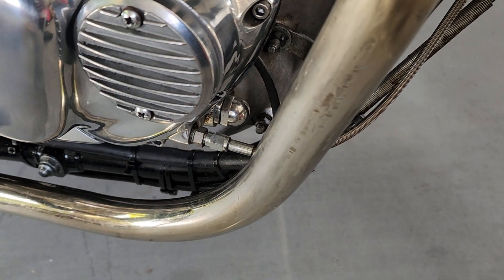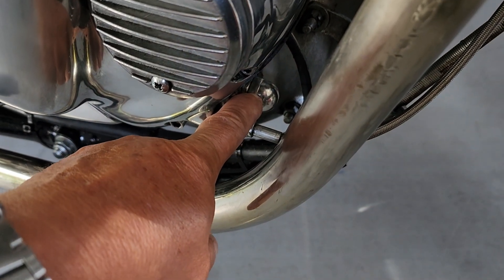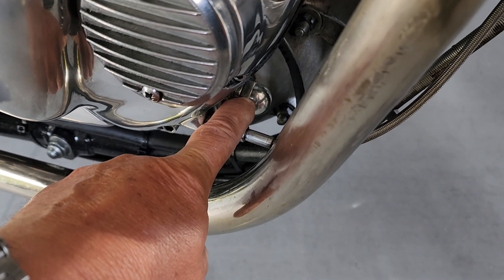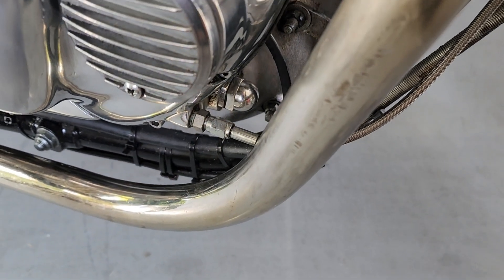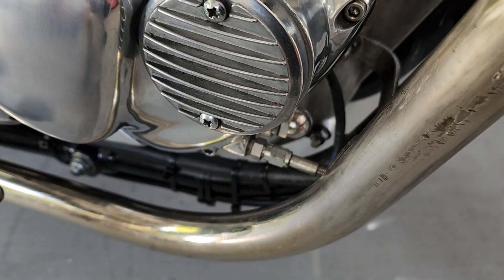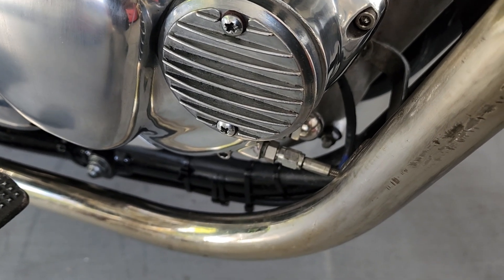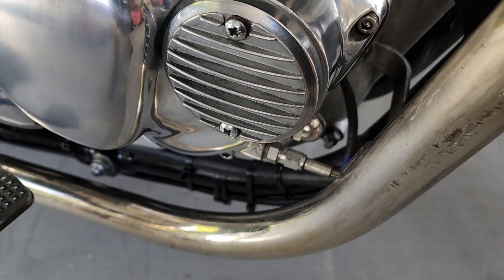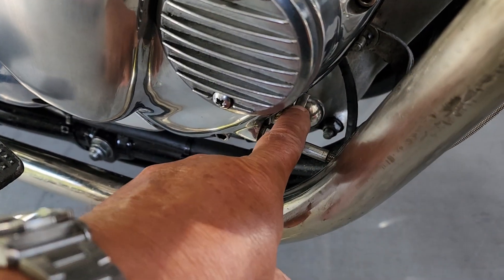Next is your oil pressure control valve, which is here at the back. This controls your oil pressure and prevents it from exceeding 80 PSI. What the oil pressure control valve does is prevent excessive oil pressure — it doesn't do anything for the low pressure side at all. It only controls the upper side, which is the 65 to 80 PSI range, and it's basically a piston, which I'll show you now.